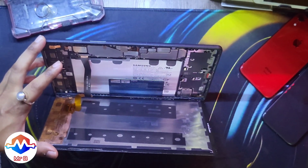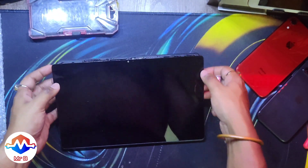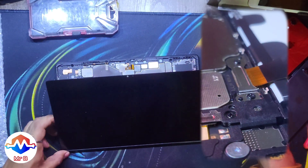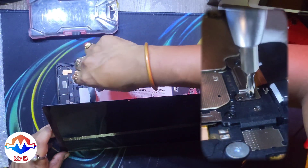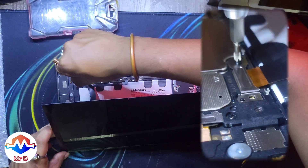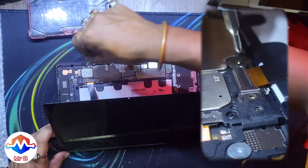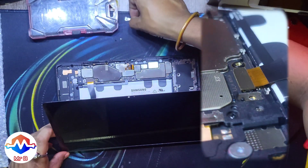Here I am using a Phillips triple-zero screwdriver. Here is a quick zoom view — there are two Phillips screws that you have to loosen, and there is a metal clamp right over the connector. Take your time and do not hurry at this section, otherwise you will run the risk of damaging the flex cable or the connector.